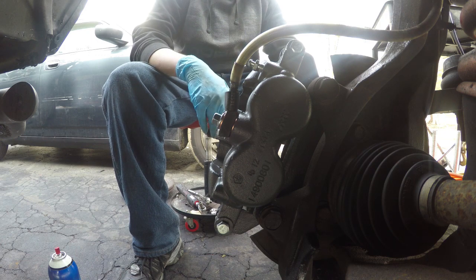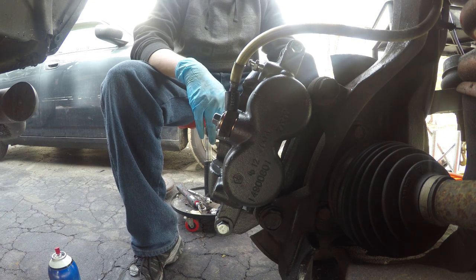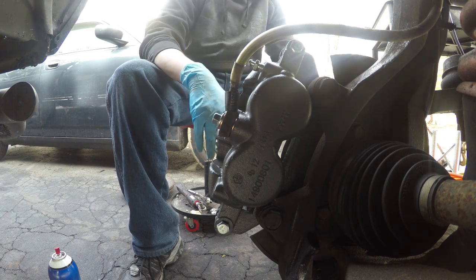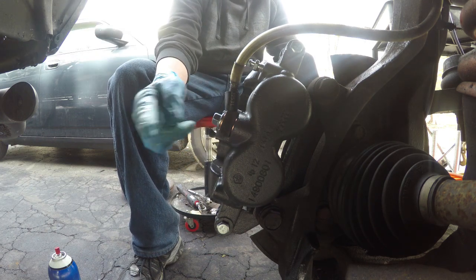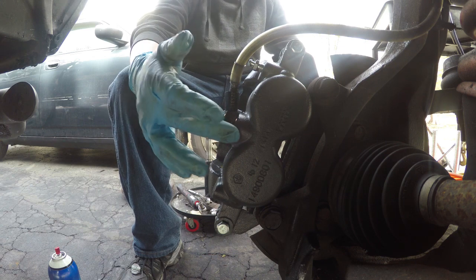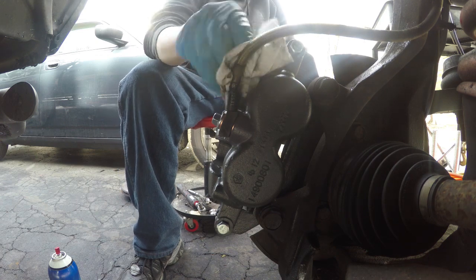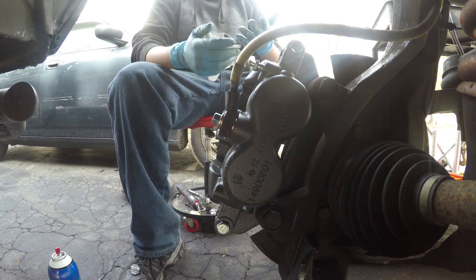AutoZone is a reliable option and hopefully it's only this side that got messed up. Once I do the brakes — I believe Sunday is when I'm getting my shipment of brake pads — I'll take a look at the passenger side. So there you guys have it: 18 foot-pounds if you're a lifted truck, 31 if you're non-lifted. New assembly, new banjo bolt with the copper washers, everything is torqued, and the caliper is bled and full of fluid. I appreciate you guys, thank you for watching — please hit that like, hit that subscribe, and stay tuned for more videos.